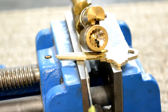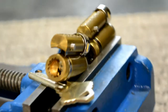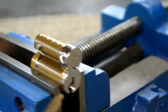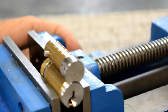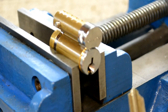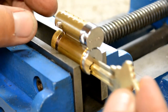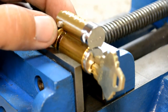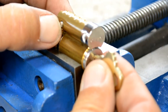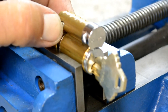There is an ability to override that and push the pin in. We're going to move back around to the front. If you have an already existing control key, here's your check pin on the side. If you insert the control key all the way and just add a little bit of pressure to it as you're backing the key out, then work it back and forth a little bit, you can see the check pin pushes in all the way.